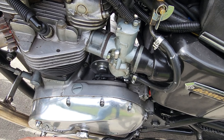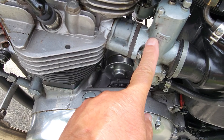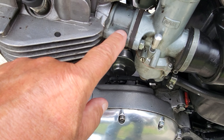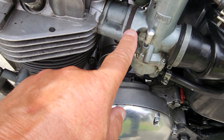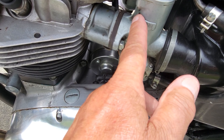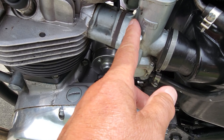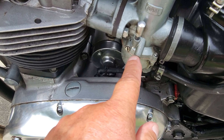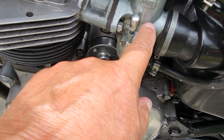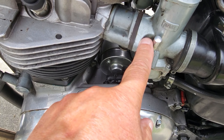On the carbs I've used a phenolic insulator to keep the carburettor cool. I've tried the O-ring system before and I find that with the phenolic spacer I get much better cooling, which is what you want. You should always be able to at least touch your carb even when it's been running, because otherwise you're boiling the fuel and vaporizing it too early, which causes all sorts of weird effects and can affect your performance.